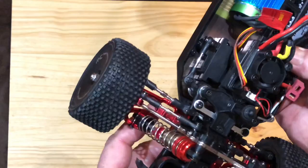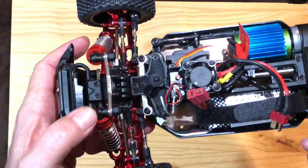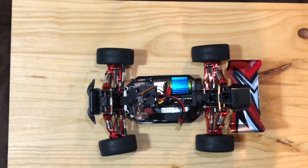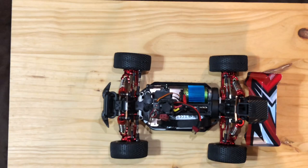There's very little plastic on this car. The top braces, the cover, and your differential covers are plastic — and the bumpers, which you want to be plastic anyway. Your differential housings are the main plastic bits. Just a beautiful car. Now it's not set up very well out of the box — the rear end seems to be toed in properly, but the front needs some adjustment.